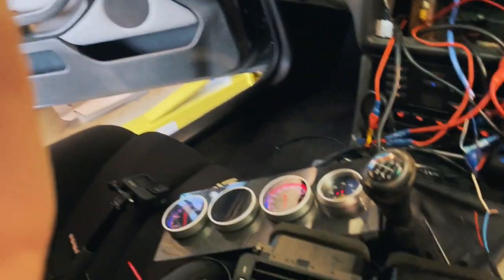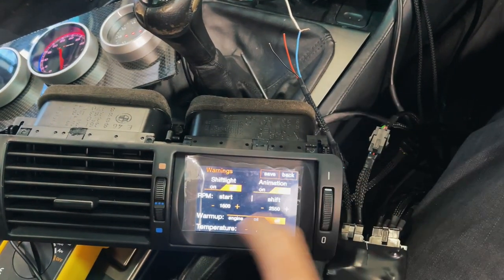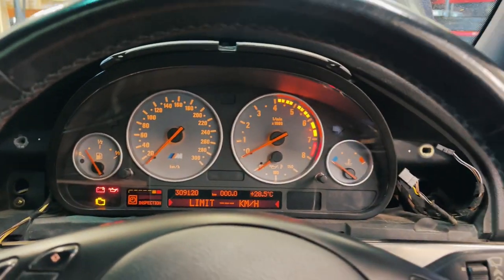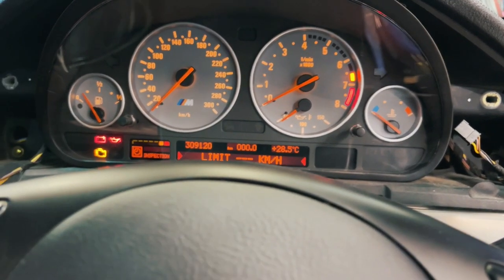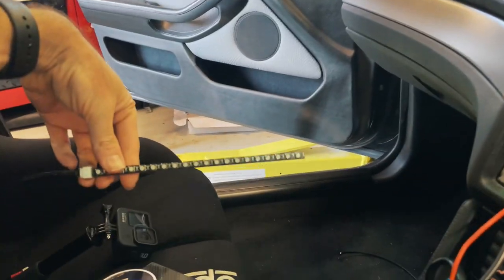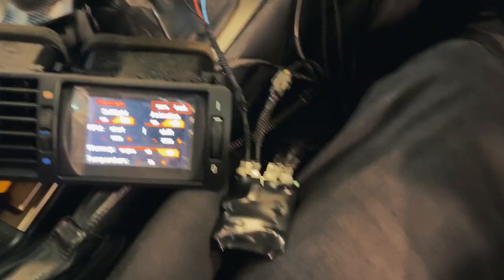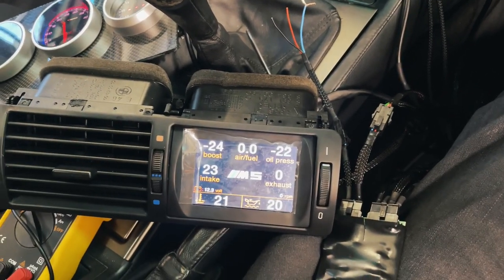As it sits, the gauge is wired into the cluster for power, intercepts CAN bus in the cluster, and is wired to the oil pressure sensor, boost pressure sensor, and the AFR gauge output wire. One thing that has come about from all this — the battery charger we bought is putting in the work; we've had the ignition on for about 18 hours straight and everything has stayed powered up. The gauge does some cool stuff with the shift light: turning it off and on controls the M shift indicator light, and you can set it so it flickers when you hit a certain RPM as a shift light. The gauge also comes with an external shift light you can mount anywhere — that's all working properly.